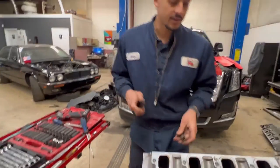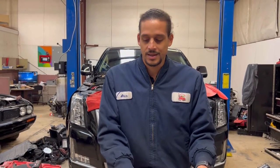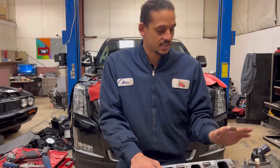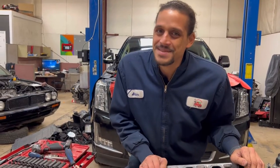The cam is going to have to be replaced along with all new lifters and head gaskets. I'm just going to redo the whole engine. The only reason we're doing it like this instead of replacing the whole engine is that a lot of people are still paying on these trucks. These engines are heck of expensive — this is the 6.2 LT motor, it's no longer an LS. I've seen them used for upward of nine grand.